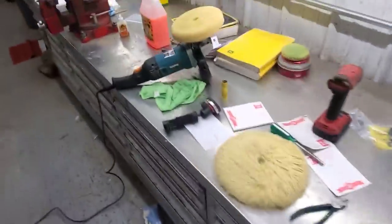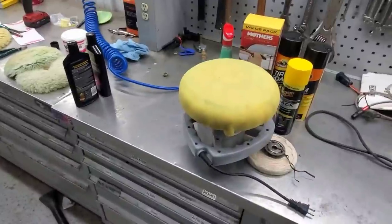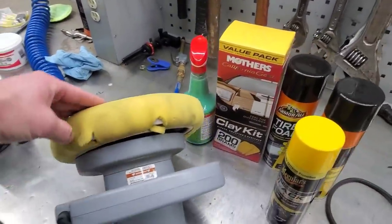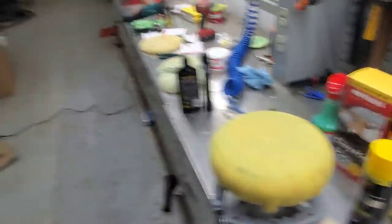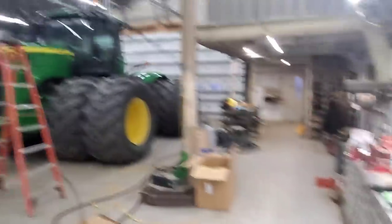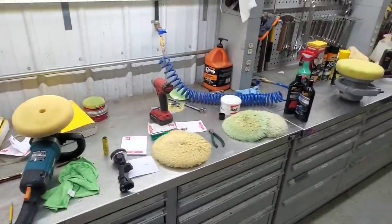For what we're doing here with the ultimate polish — it's a little bit finer and should shine it a little better — it says to use foam, so I've got a foam pad for that. I also have a DA random orbital buffer with a foam bonnet, but it's kind of falling apart. This one is not nearly as aggressive as the rotary but it's more forgiving on edges and curves where you've got to be very careful not to burn through.